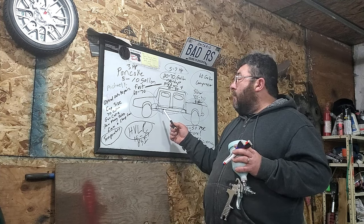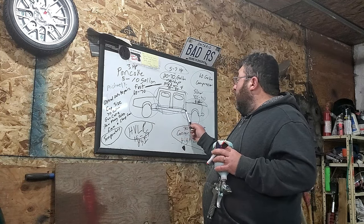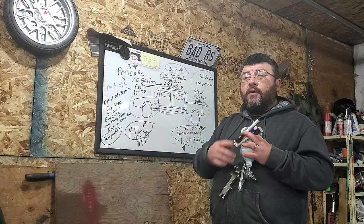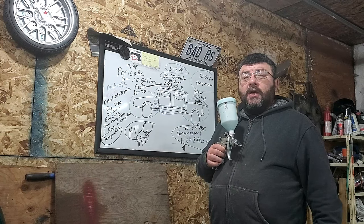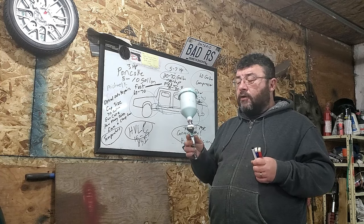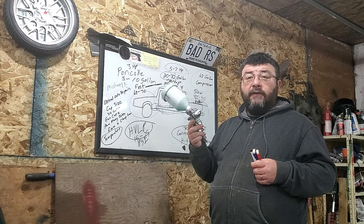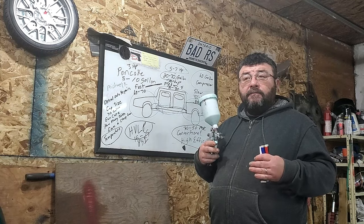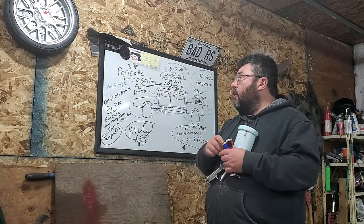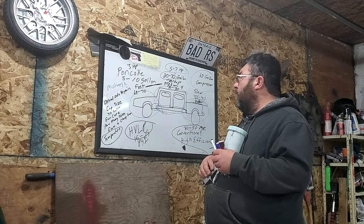With a small compressor you're going to be working on maybe the bottom of a fender, the edge of a bumper, possibly a rocker panel depending on how big it is. The biggest thing to remember is you want to be painting where you have a full stream of air. If your air pressure goes down, it's just going to be fluid coming out of your gun. If it's a gravity gun like this, you won't get the desired result. So if you have a small compressor, keep your paint areas as small as possible.